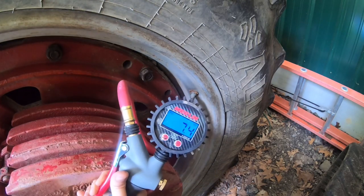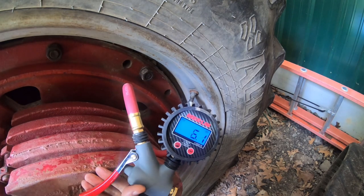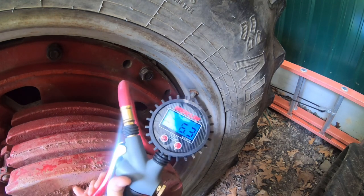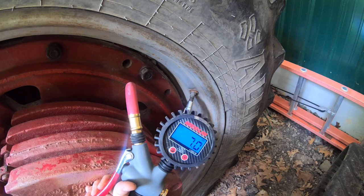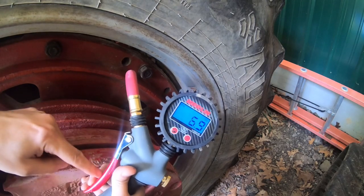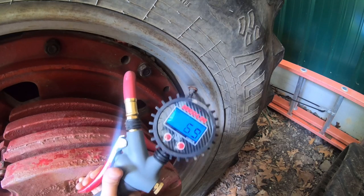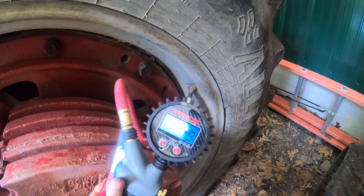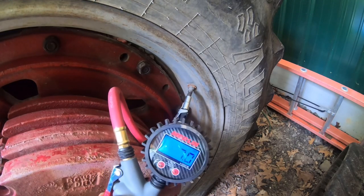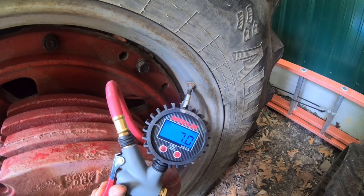The Lock and Flate is much simpler. I'm holding down the air valve on my Harbor Freight Merlin air chuck with a digital pressure gauge, and I'm working way less hard. We went from 4.1 to 6.1 in maybe a minute of talking. It's going to take 10 to 15 minutes to fill this up to 23 psi. This lock and flate went on real easily, had no leaks, and I'm very impressed with it. I'll get this up to 23 psi and we'll finish this out.